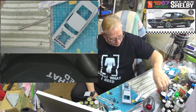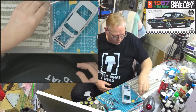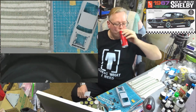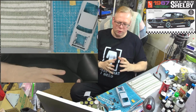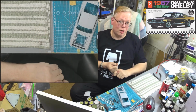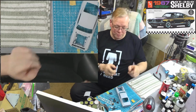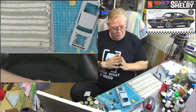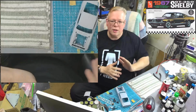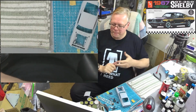Okay, so guys, that is going to be it for today. I know this is a short video, but that's kind of the nature of doing the body work on this. You do one quick thing and then you've got to wait a long time, right? I've got to let this primer cure, and I need to let this putty cure, and then I can attack it with very fine sandpaper. Maybe I'll do like a 10,000 grit just to take any dust imperfections out of the primer, and then next time we'll do some color.